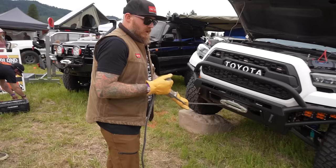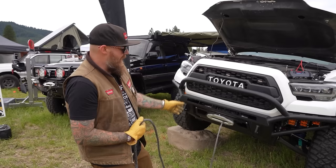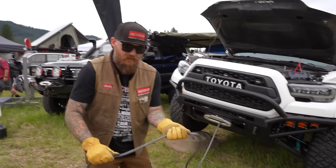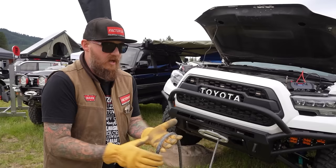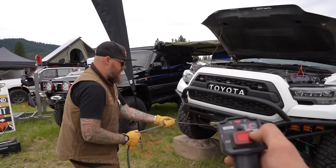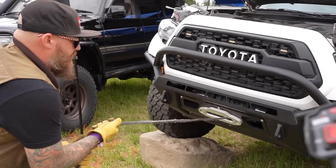When your winch line is going in, you never want the rope to just slide through your hands. You want to go hand over hand, leaning back and putting some tension on it to allow that to go through. You can even see just how dirty your gloves get just from handling this rope. You never want it to slide through because you don't know — did it pick up sharp rocks? If you're out in the desert like in Baja and had to winch something out that had cactus thorns, anything could be in there that could cut your hand. Going hand over hand allows a slow, controlled movement to also watch the rope stacking up on the drum evenly.